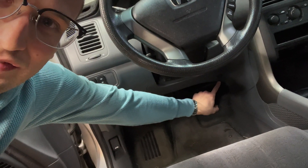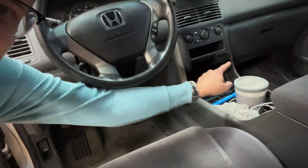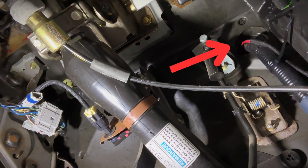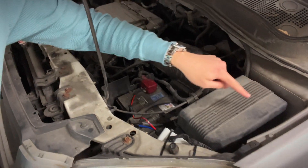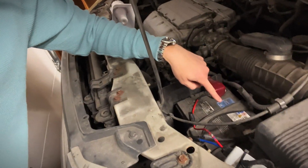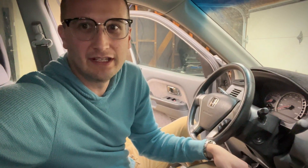I don't think I went through that well enough yesterday, so let me show you again how this works. We have the kill switch there, wired to a box back there. That box gets power from a fuse tap in the fuse box on the other side. The box runs through the firewall and into the engine compartment, where the wiring gets routed to this box containing a relay. That relay takes power straight from the battery and sends it to the alarm over there. Now I want to try it one last time to see how loud this alarm actually is — three, two...